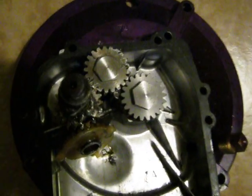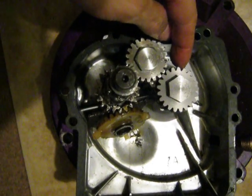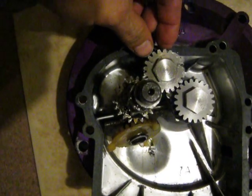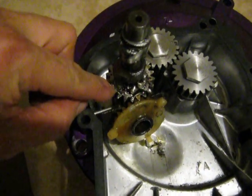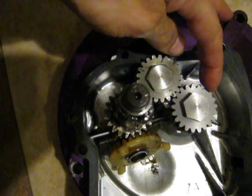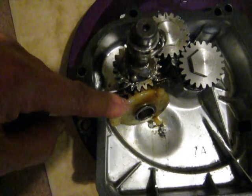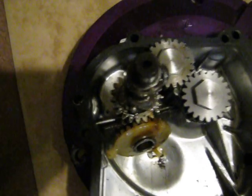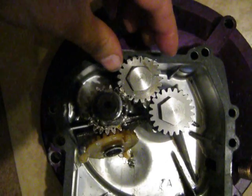I'll show my setup here for the Briggs engine. I've taken the regular crankshaft gear, then another crankshaft gear and a third one, and welded this to the camshaft. Now the camshaft spins the opposite direction that it used to, and it also spins the oiler backwards, but that hasn't caused me any problems so far on my poppet valve two-stroke.